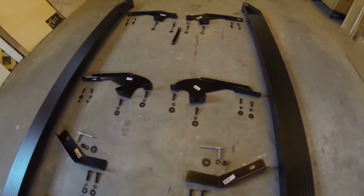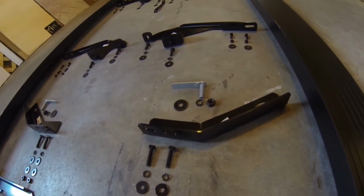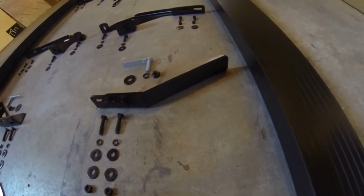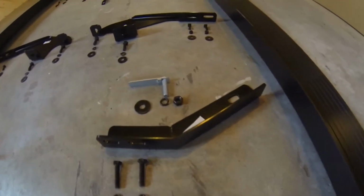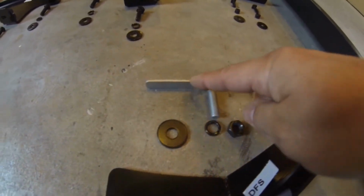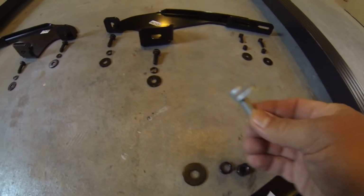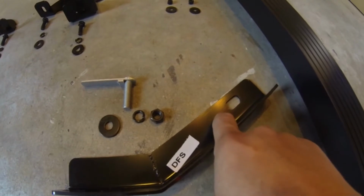Now moving up, here we have a hex plate. Where did I see that? Oh, that's embarrassing. Bolt plate, yes. This is a 10mm bolt with the plate. Under the frame, there's going to be a hole. This is going to slide up into the hole, and then it's going to twist and lock into place, and that's going to allow this bracket to get mounted to the frame.